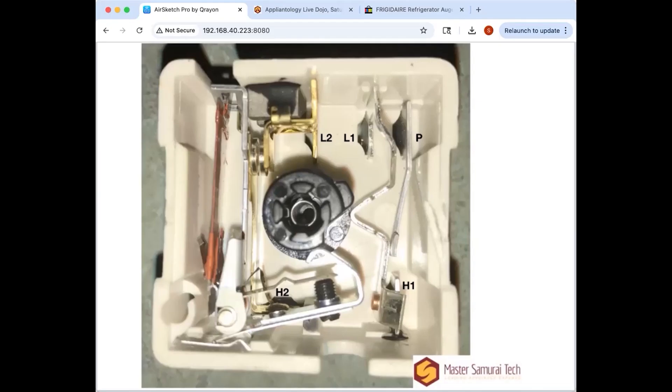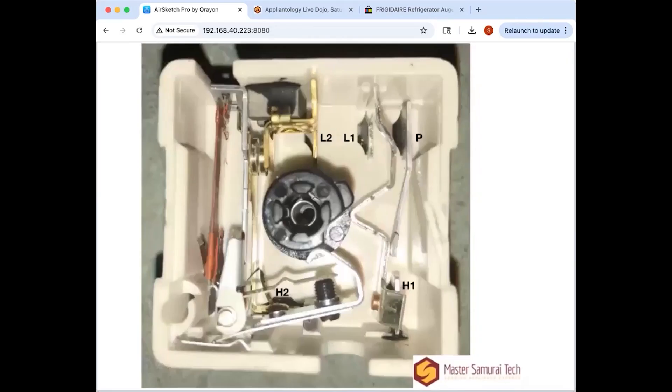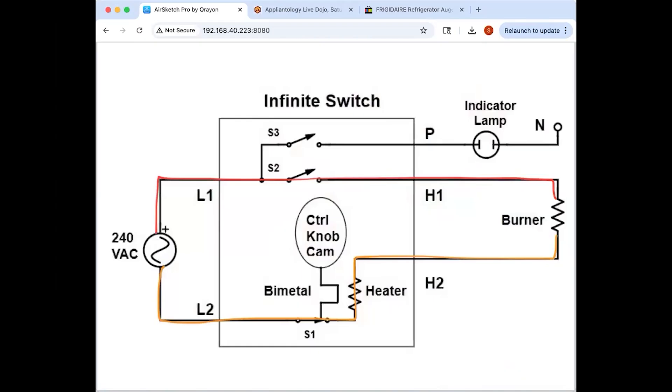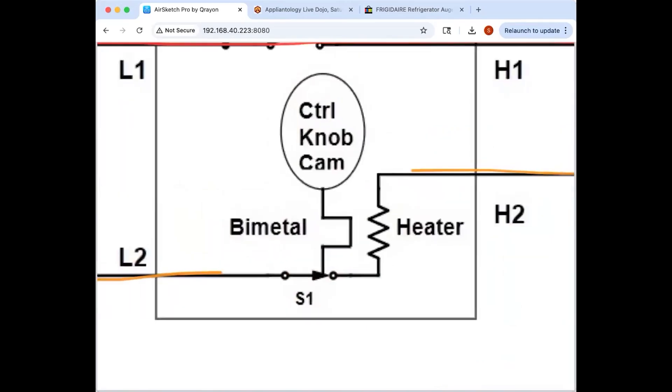Once you have the cam set to put pressure on the bimetal via this lever, you're going to resist that bimetal popping open as quickly — that's all that's going on in there. You've got the other side flipped around. These are the spades that stick out on these sides. The basic operation: bimetal and mechanical action. On the schematic the bimetal switch is this switch right here — they've got the little temperature symbol above it, a temperature-controlled switch with mechanical bias from the cam.